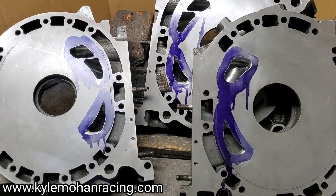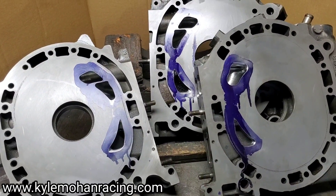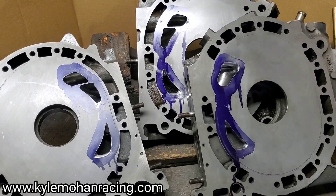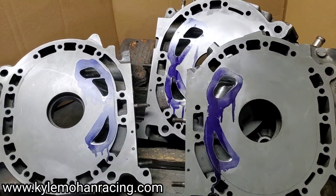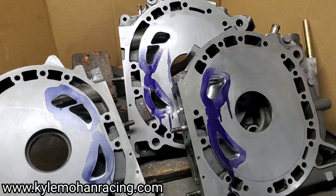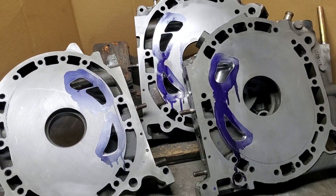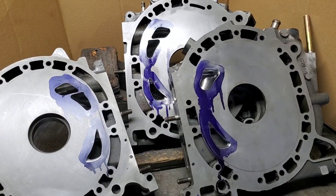Realistically, the porting gains on an RX-8 are not as great as the porting gains on an RX-7. However, I still recommend RX-8 porting if the motor is already apart. I would not take apart a good running RX-8 just to port it — the gains aren't there. But if the motor's apart and you're already doing substantial work on a performance-based build, then absolutely street port it, half bridge it, bridge port it. We're always working on new port designs here at KMR and Mazda Trix.